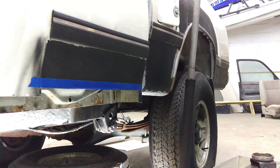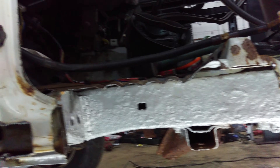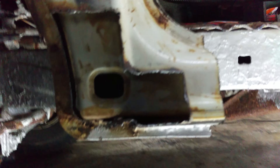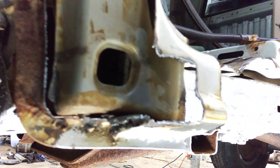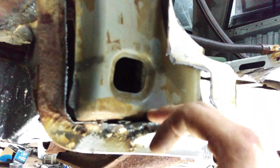Right here I need to figure out what I'm going to do. It's solid — just surface rust — but I want to prevent any further growth. This area is pretty solid too, so I might cut straight across, over and down, because we have this whole entire chunk. Maybe it'll be easier to cut it all out and weld in the new piece instead of trying to go around and down. That way we're working with a perfectly straight rectangle.